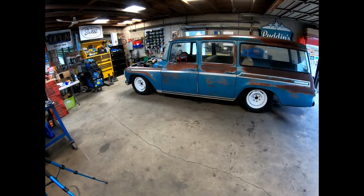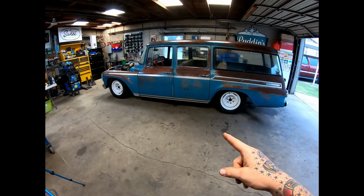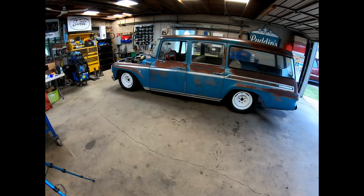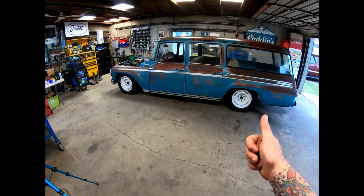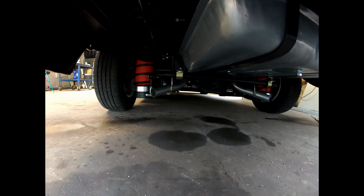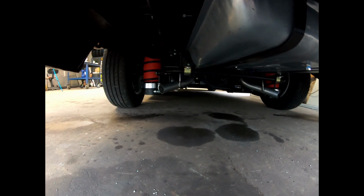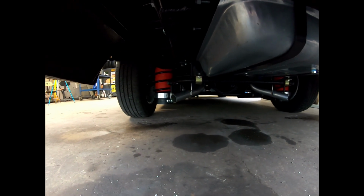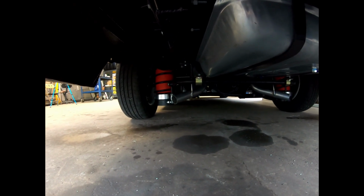I almost forgot to tell you guys, this thing's fitting perfect. Maybe you can see the little bit of rake to it. Still tucking tire, but looks mean. That's because I lifted the back up 1.5 inches. So underneath that coil spring up there, you can see that shiny spacer. That's just an aluminum piece we machined. It's 1.5 inches to lift this thing up.